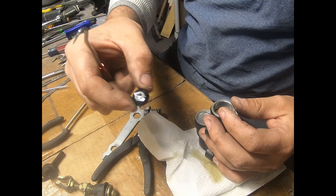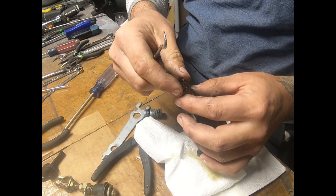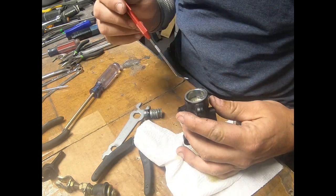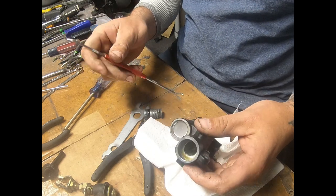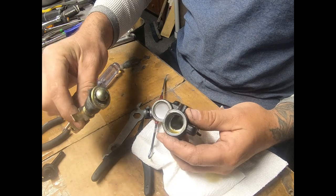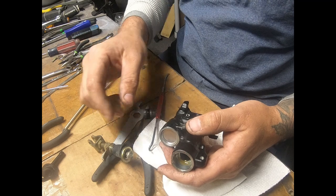The flat side goes up when you put it back together. Then we got the spring. There's a bunch of crap in there, but the walls look good, everything looks good on it. So what I'm gonna do now is give all these parts a nice little bath, use compressed air, blow out all the passages, make sure they're all good, and then we'll put it back together.